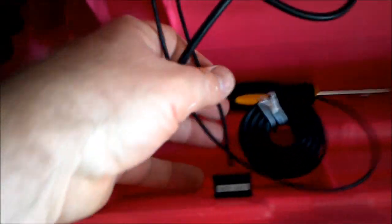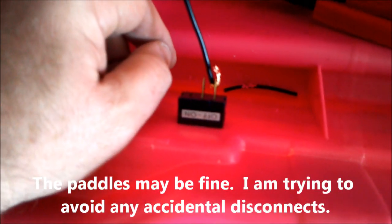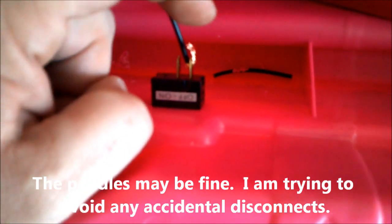Now they can reach back here to the switch. They'll solder on here — I've got to get this one heat shrinked and cut to length. The wires are heat shrinked and I ran them down, took these screws out, ran them down through here, and put them in. They come back through the little hole. They run back here through the little hole, and then what you want to do is strip off a good amount and feed it through the little hole on the switch peg coming off the switch. It doesn't matter which one you go through, but you've got to get it through one of them. This one here is already through, and once it gets through, you want to solder it on.